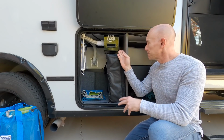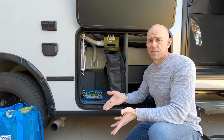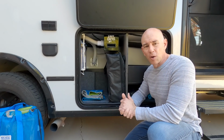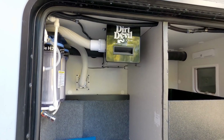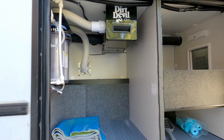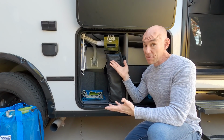All right, now to installing this central vacuum box. This is actually probably the most difficult part of the whole install. The box is about 6 inches by 7 inches by 14.5 inches. So that's kind of what you got to make room for. And it can be mounted in an out-of-the-way place. That's the benefit of the central vacuum, right?